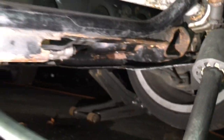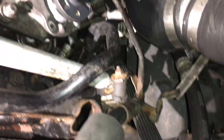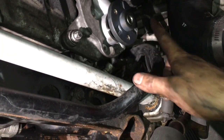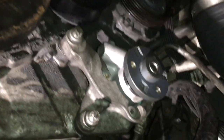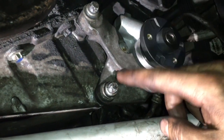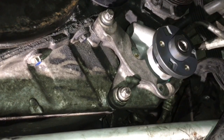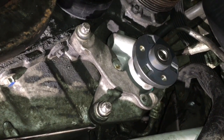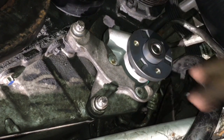Put this back together with this cooler piece right here. Make sure that this line right here tucks underneath this, so the bolt will be right here — it was a little confusing and I had to redo it a couple times. These are the two front mounting bolts, so start those first and then put the back bolt in, then tighten the back bolt, then tighten the two front bolts. Put this on without the pulley so that it makes it easy to install — otherwise you have a lot of interference with these lines. Then you can slap the pulley on and bolt it on.